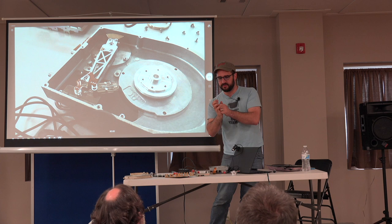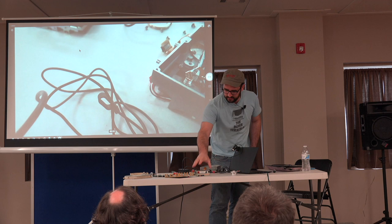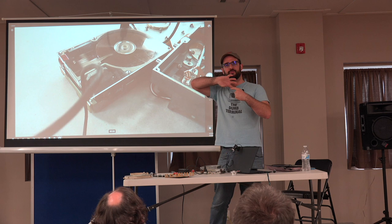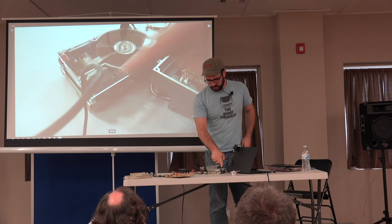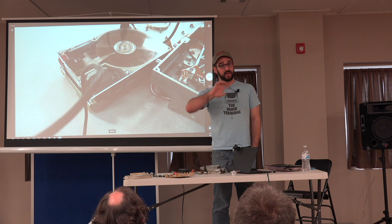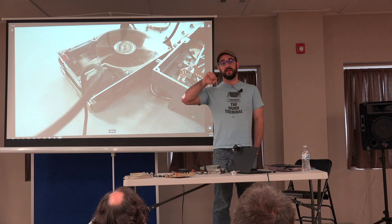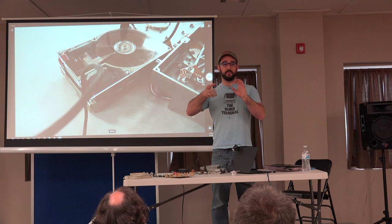that grease. And I've seen that on these MiniScribe drives as well, where when the motor is doing small seeks, it'll work, but then when it goes to do a big seek, you'll hear this kind of bearing screeching sound, and the head gets stuck. Now on these, you can generally drip a little bit of 3-in-1 oil externally on the stepper motor, and it will free it up. On an ST506, I did actually have to take the drive apart and put a drop on the inside of the stepper, inside the drive, because the bearing was just too gummy.